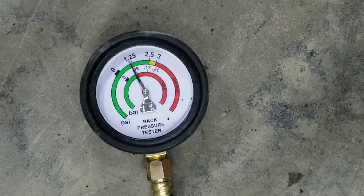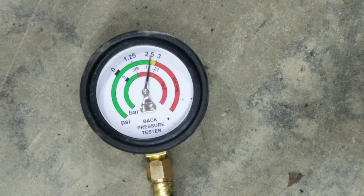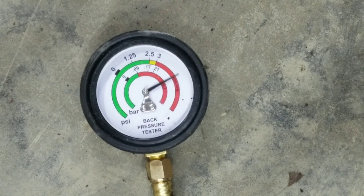I'm doing a voiceover here because with the vehicle running you couldn't hear me. I went from idle to 1,000 RPM, then held it around 2,000 RPM, then briefly got it up to 3,000, and before shutting it off I held it at 2,500 and then let it drop to idle. I've definitely got a problem on the passenger side. I thought it was the driver's side, but all along it looks like the passenger side has too much back pressure. Very interesting — totally unexpected.